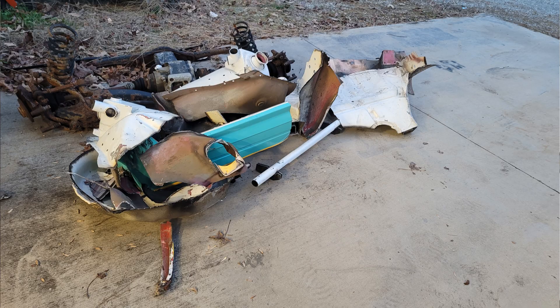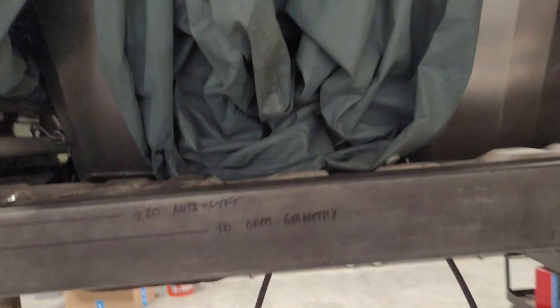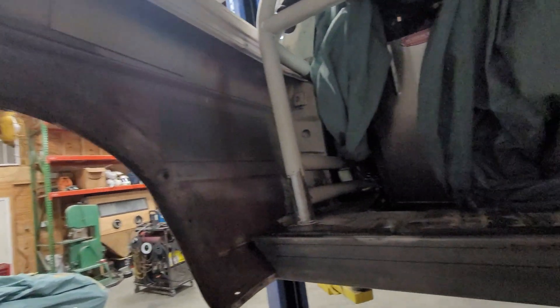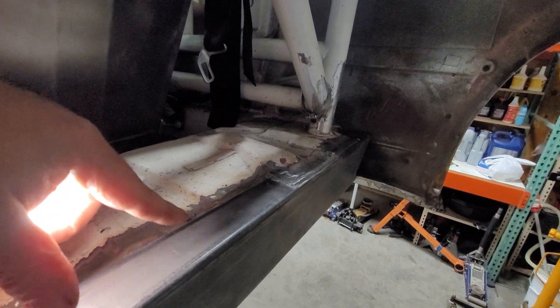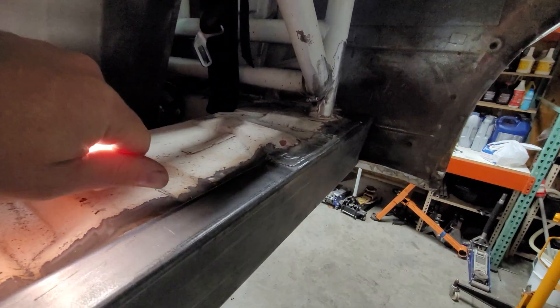The car's been cut apart and everything's out. I'm standing where the fuel tank was, where the old torsion beam system was, where the struts and inner fender wells were. All of this has been buzzed out, making a lot of room — there is absolutely no issue with the rear subframe fitting in this space. On top of that, I went ahead and took out a bit more material and added a two-inch by four-inch box beam as eighth-inch wall, which will serve as the pickup point and starting points for the rear suspension trailing arm pickups.